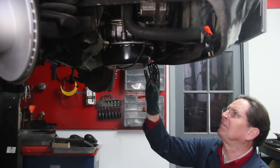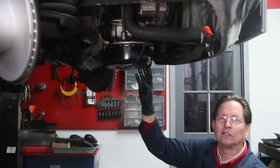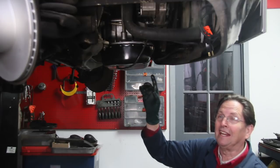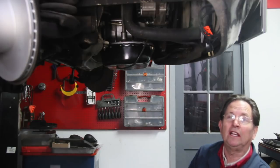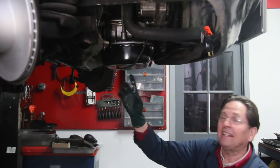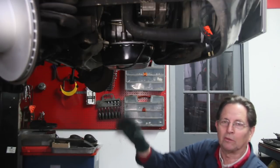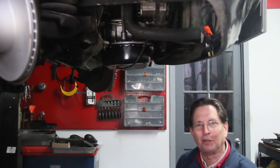I've put together a kit on how to do this yourself — it includes complete video instructions. I also want to show you a couple of other things I've put on this pan that are pretty neat. This item, which is this pad heater, is an engine oil heater that goes on the bottom of the pan. It only takes about 15 minutes to install, and it can be another great reason to reduce moisture buildup in your engine oil on a car that does not get driven a lot. So I want to show you now just how strong that magnetic drain plug is that I put into this pan.